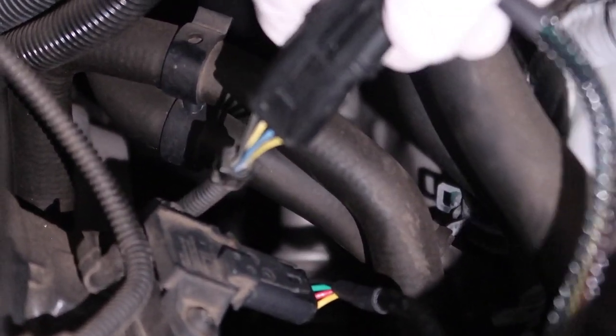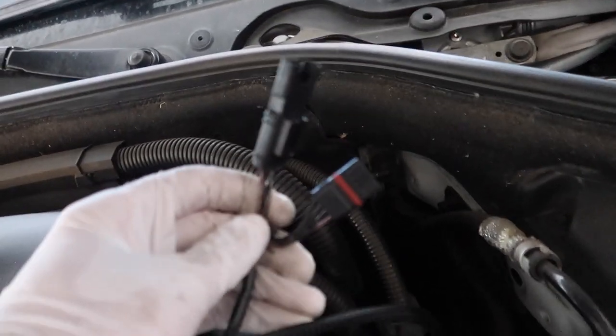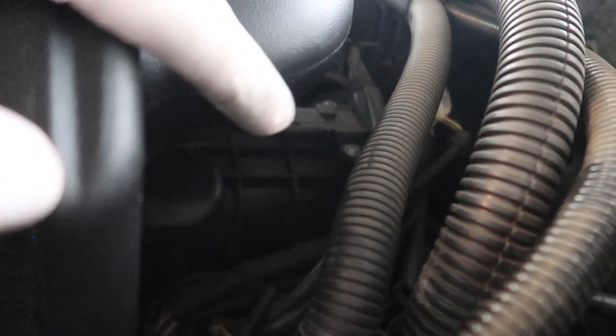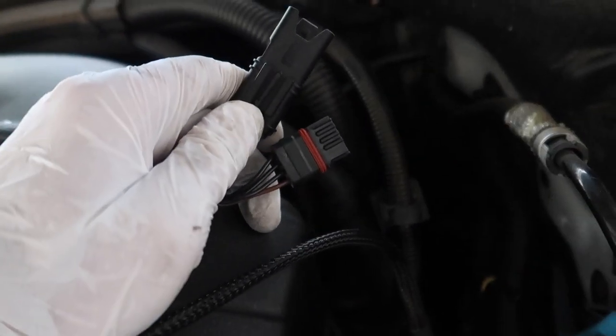So looking at it right here: I have the cable coming out of the car into the harness, and the other piece of the harness goes into the actual sensor on the car. The male head plugs into the harness female head, and then this other male head goes into the sensor itself — that part is very easy. The next sensor we're plugging in is the MAP sensor, which is right underneath the intake. The rainbow cable is for the MAP sensor and the other cable is for the T-map behind the intake.